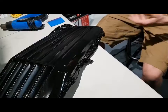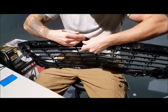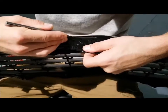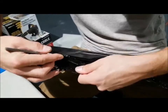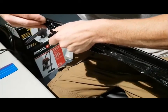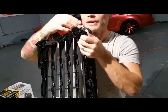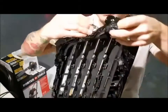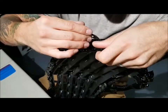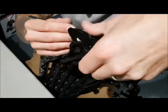We don't need to leave tons of film on the opposite side. What I'm going to do is just trim on the backside of the chrome. There's a little rubber gasket or rubber seal that runs behind this — I'm going to run the back of the blade on the backside of this chrome grill. Like I said in other videos, the more film you leave around your edges you might think it's adding security, and it will — but if you're doing it properly, you don't need to leave heaps of film on the opposite edges. You can see that's a little bit loose and I'm going to heat that up and roll it over afterwards.